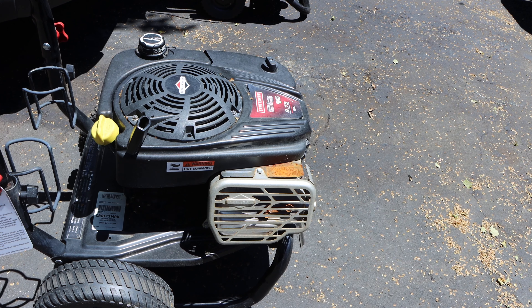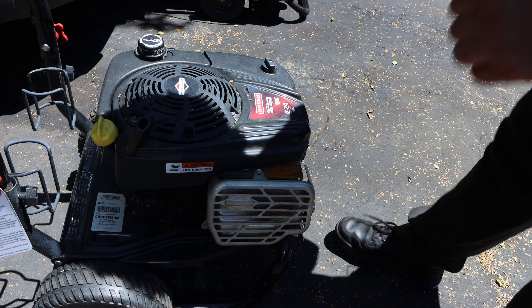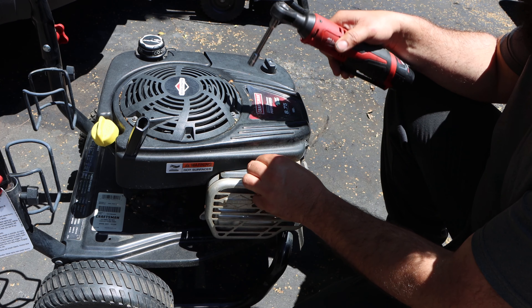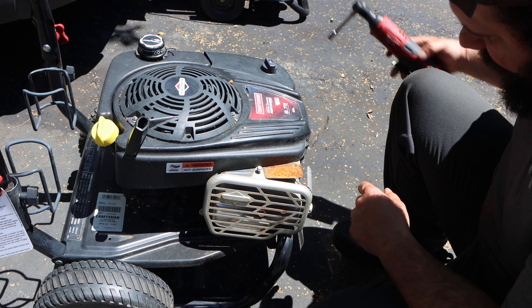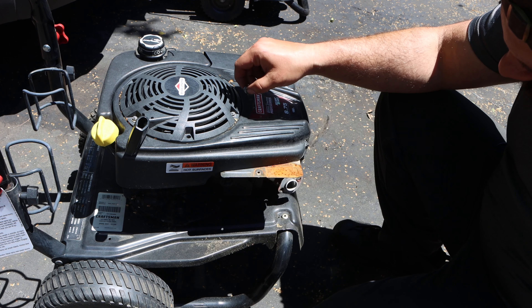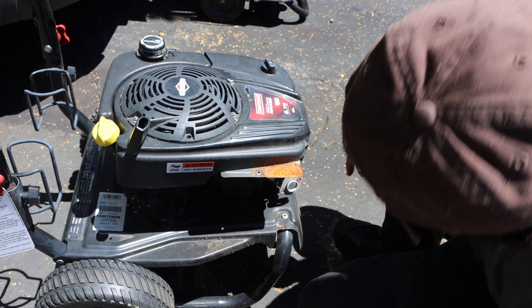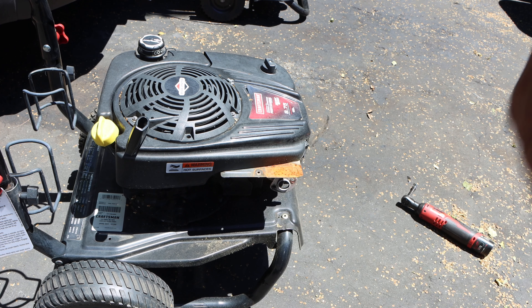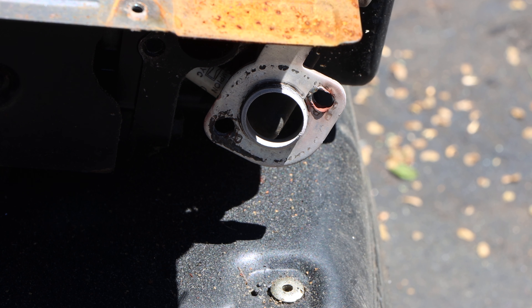Let's dive into the troubled area first. This muffler assembly is loose from the shield to the exhaust housing itself. We're going to be removing the 5/16ths screw and hopefully free up this muffler so we can get inside the bolts. Usually there's a series of two or three. This is getting to me in pieces with just that one. Also, where that rust part is, that is your ID tag for the muffler — if we get this thing working, I'm going to clean it up and paint it. Looking at the exhaust, there's a spring-actuated temp sensor. As the exhaust gets hot, that spring opens up the choke and gives the machine full power.